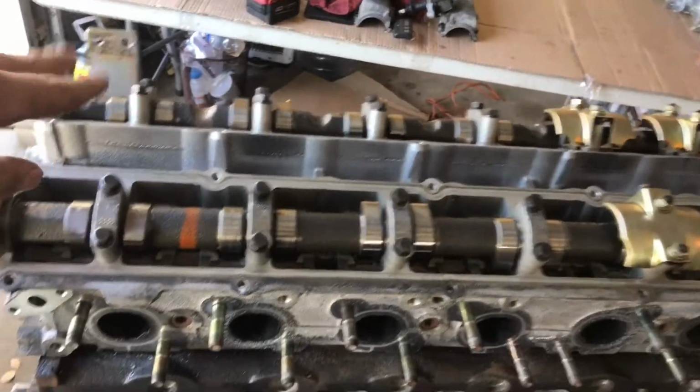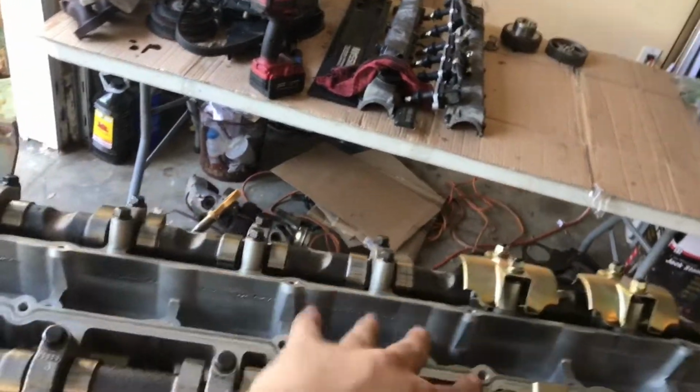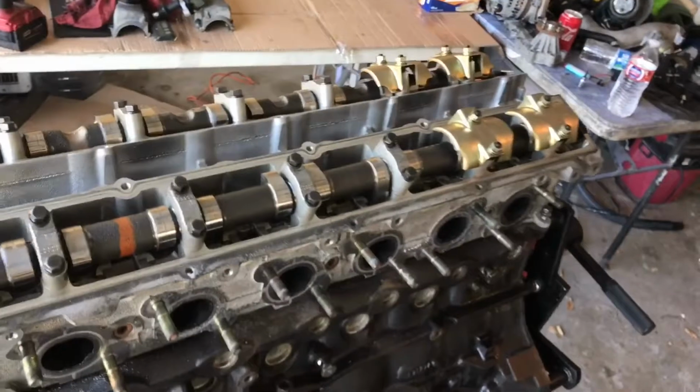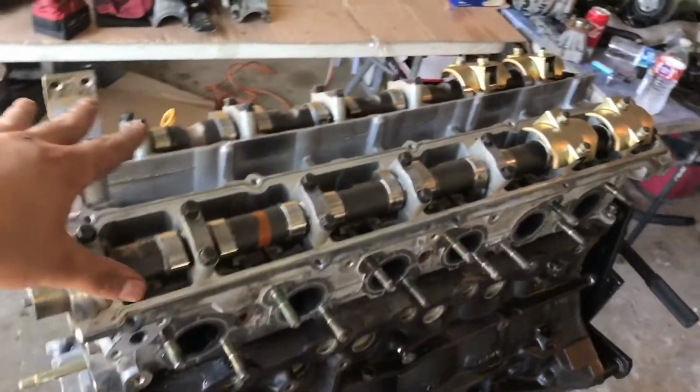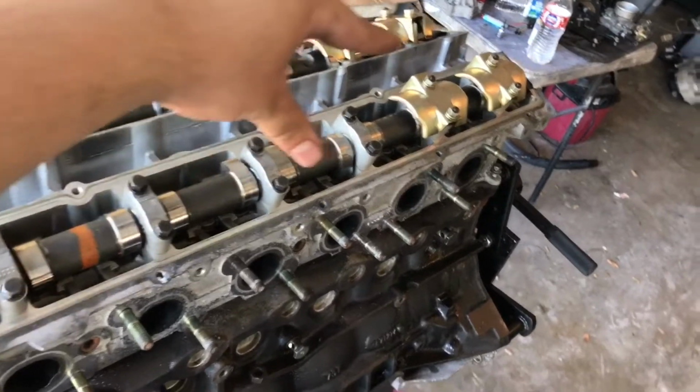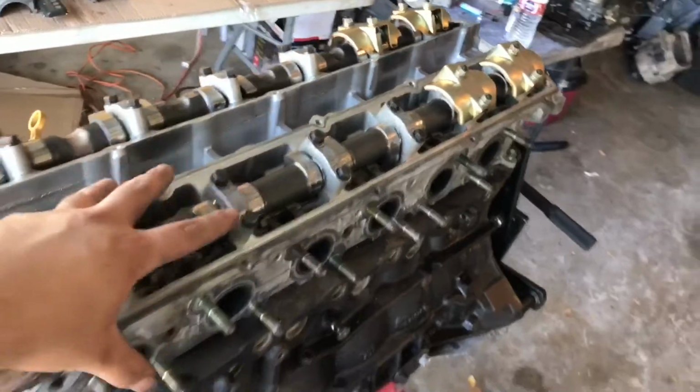So we'll start off with a cross pattern. You know, we'll go here, here, here, here, like that. Your regular torquing. If you guys need the torque specs, just get the service manual. It's online. Everything is online nowadays. So we'll go ahead and remove it in a star pattern, I guess, but from the outside in, and we'll go ahead and pull the whole head off.